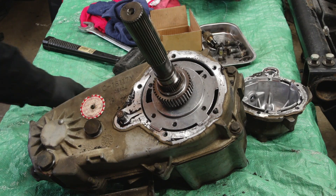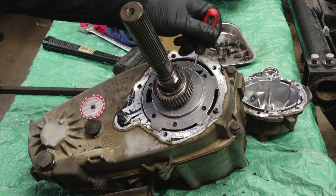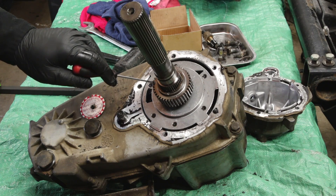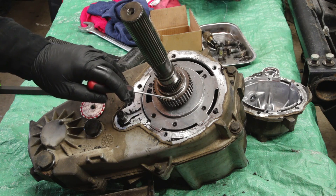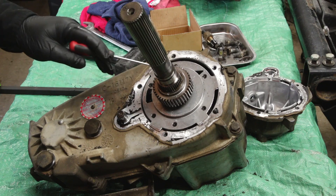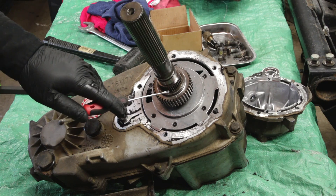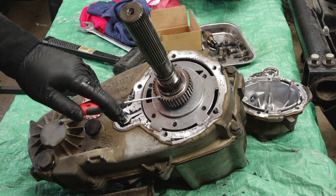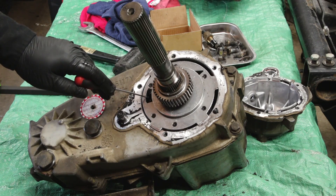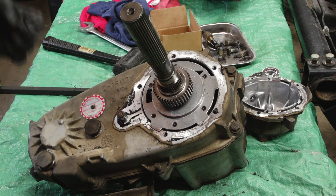Now that we got the cover off, we've got another one of those snap rings that are not our friend. This is your gear for your speedo — there are 40 teeth on there. So if you're doing an LS swap, it's important that the signal is just 40 teeth, or you've got to buy a signal converter depending on how your swap is going. We need to pull the snap ring off, lift this gear off — this is your oil pump here — and then we can remove the bolts on the outside and pull this front cover off.